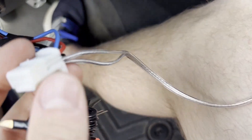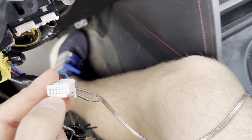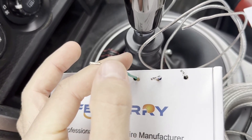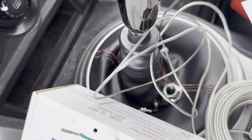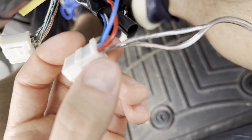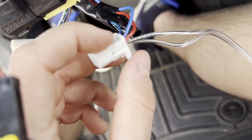You can then pull on the pins, but they're very tricky — I've definitely broken a couple of these pin connectors. That's actually a main reason I made this video: so you don't have to know all these details or take apart the pin connectors yourself, because I already did it to figure out which pin was which. Once you've got your wire in, it goes in the back and you shove it until it clicks. You may need a pick to work them in if they're a bit large. Give them a tug test, and when fully done push the clip down to lock them in for good.